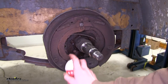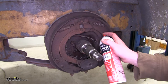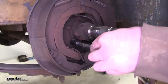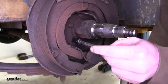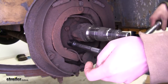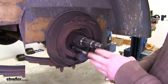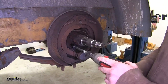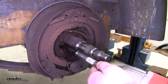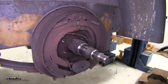Next we're going to take off our entire brake assembly. We're using some penetrant oil on the bolts to help those come loose easier. You want to break them loose by hand first. Our bolts here use a 15 millimeter socket, though yours may differ. Once you've got them all broke loose, then you can take them all the way off. We can set those bolts aside.